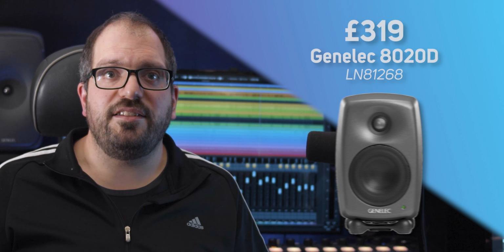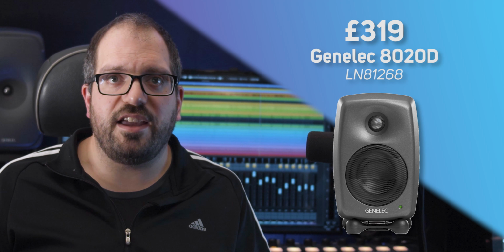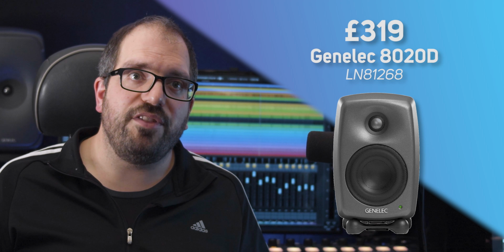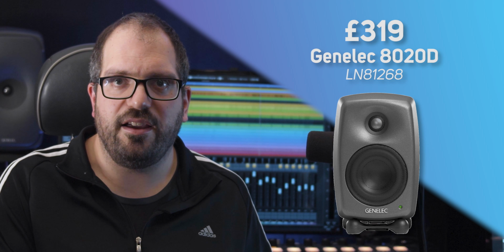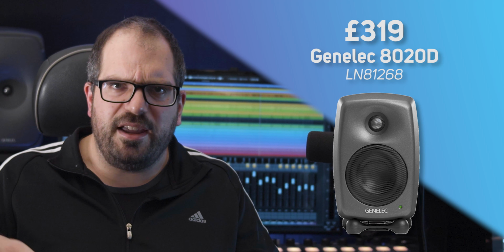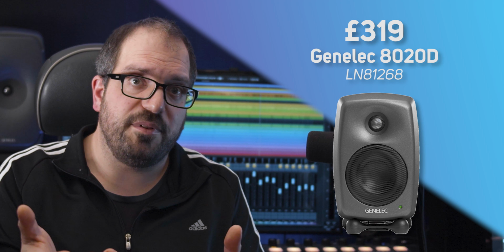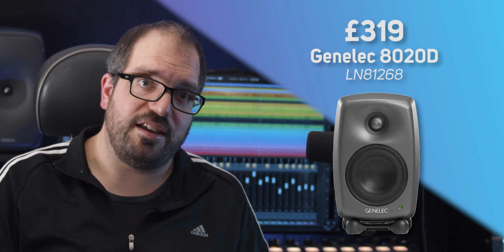Next, the Genelec 8020D. Well, try finding a Soho edit suite or a broadcast truck that hasn't had a set of these in at one point. The pros love them for their spoken word clarity and the great translation for TV and video work. They can be a bit boomy when they're pointed up on the desk on their own isopod stand that comes with them, so enable the bass roll-off switch on the back to compensate for this.